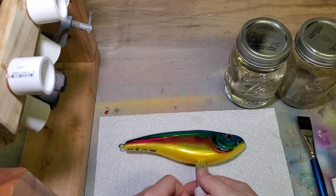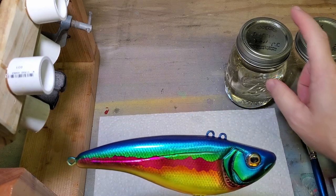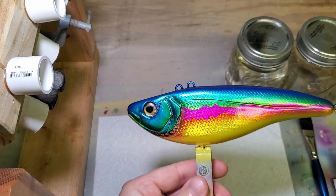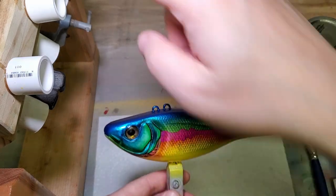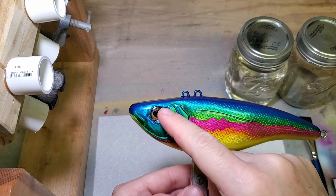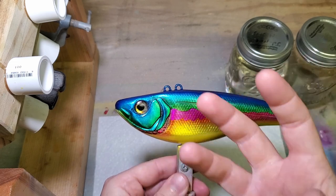I believe we're ready this morning to get started with some clear coating. We're going to continue on with our KBS Diamond Clear. I've done a little bit more research on it and reading, and I think where I went wrong earlier was putting it on my rotisserie and rotating it. And what it did is allowed some of that KBS to build up in the deeper spots, which formed bubbles.